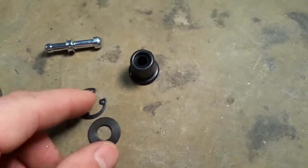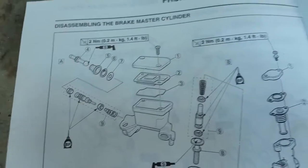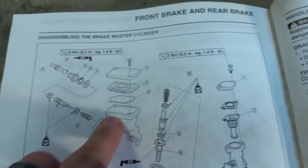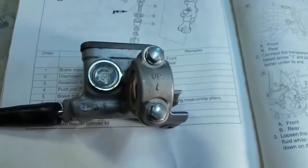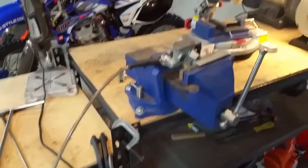This one has a lot more solid feel to it. Same with the washer and the clip — they'll just do better. We're going to pull that circlip out as well as that washer, pull everything apart as you see in the diagram. All these parts will be removed, then we'll clean everything out inside the master cylinder. Even though the fluid is pretty fresh, we're still going to remove all that fluid and inspect everything inside.